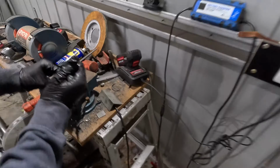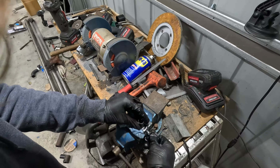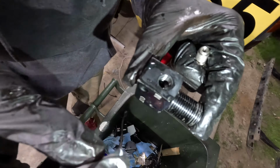So basically what had happened with our knob was someone on the team tried to screw in some wrong fittings. It was the right thread, but the fitting in the knob was concave and the fitting on the line was convex. So it just didn't work properly, and because it didn't feel tight, because it wasn't actually seating, they tightened it a bit more, and it actually damaged the seat on the adjuster a little bit. It wouldn't normally be a pain apart from the fact that we were like 2 days away from having to be on the racetrack with this thing. So I ended up just having to source another one.